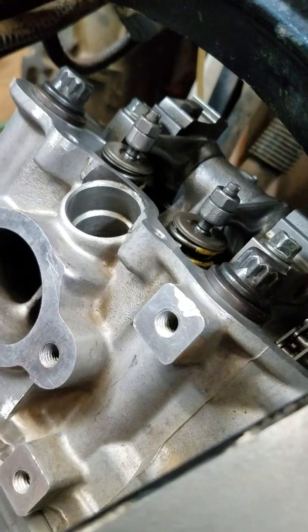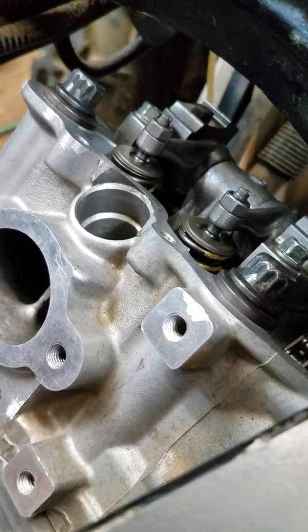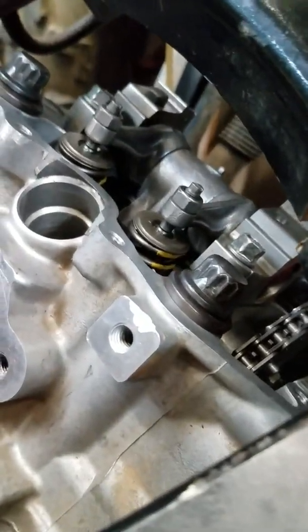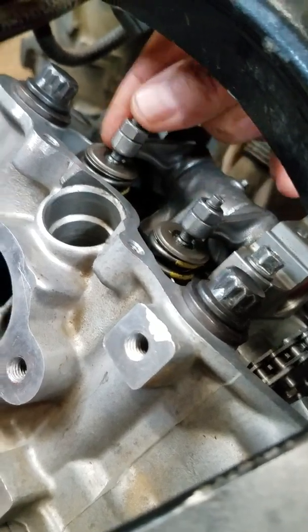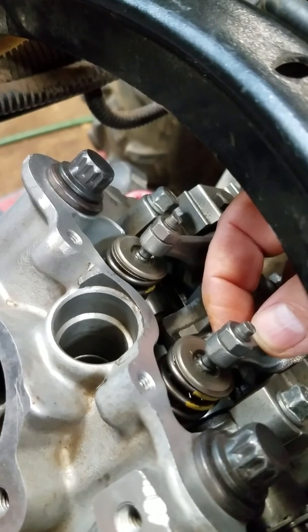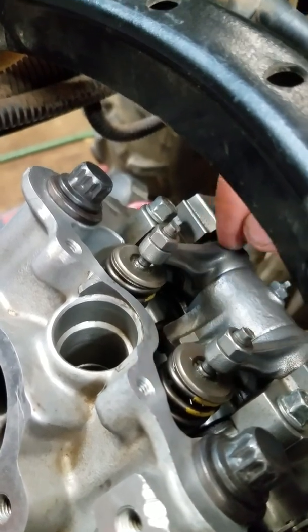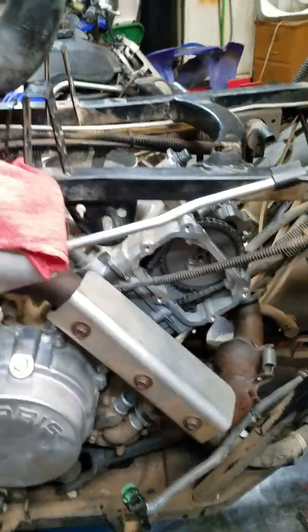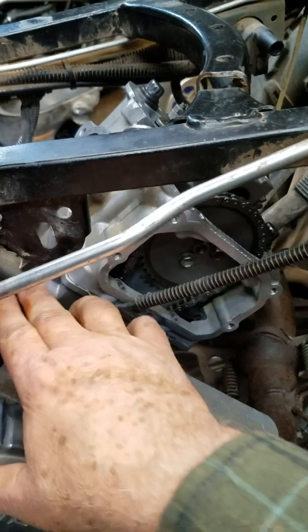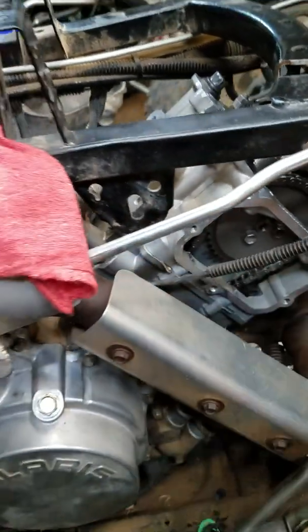None of us here are messing with one-tenth of one horsepower — it doesn't concern me. All my stuff runs good. In my opinion, a lot of people go much too far with all this stuff. But this is right and tight and solid. See this? You can see six thousandths right here — see that? Six thousandths, and you're good. Feel free to comment; I repair stuff, you can ship me stuff — heads, carbs, whatever, I do it all. I'll leave comments and answer them; I've never not answered anybody. I've got other videos on this exact machine, and it's all very similar — that's how you do the valves on all of them, pretty much. I've got a cam chain tensioner video, how to check if your cam chain's worn out or not. We'll see you next time, thank you.